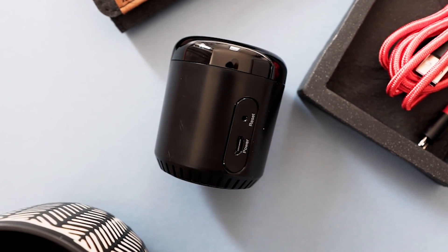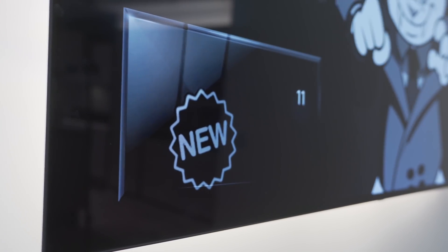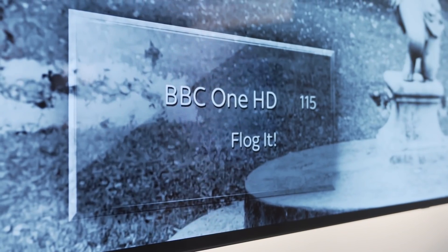This is where the RM Mini comes into play, showing you how inexpensive all of this is. The RM Mini is how I'm going to sit here at my house and control all the channels on the Skybox. It's about £17 — you connect it to your WiFi, tell it what set-top box or TV you have, download the app on your phone, and now on my phone I've got a full-on Sky controller. The app also lets you tie it to Google Assistant or Amazon Smart Assistant, so I can say 'Turn on BBC One' and it will activate BBC One, pipe in the channel number, and the channel changes.